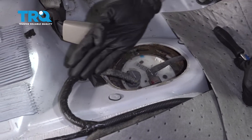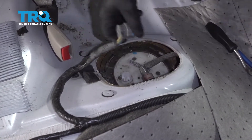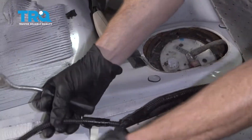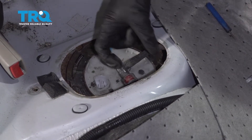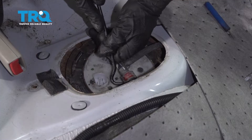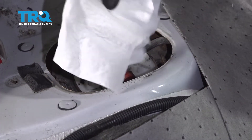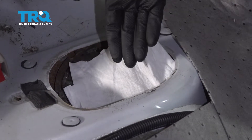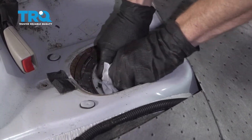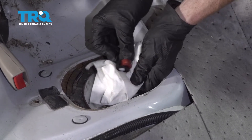Next I like to start disconnecting the wiring. Squeeze on the tab located on the side, pull it up — this is gonna keep falling in your way, so I just take a forky tool, get underneath here, pop this out of the way. To remove the fuel line, you're gonna find there's two tabs that you need to press in on and then draw this up — one on this side and one on the other. Carefully press in on that tab to release the locking tab. Then take a rag and place it over this area while removing the line, because there's still fuel pressure inside the lines and you want that pressure evacuated into your rag. Make sure you drain out any fuel that might be inside the line and then set it aside.